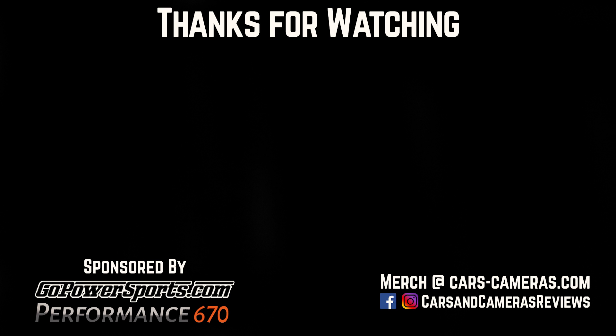It looks professional. Sandblast makes a world of difference for paint. We used a factory 670 muffler - I cut the flanges off the factory muffler. Then Performance 670 supplied us with two U's, and I chopped up the U's to make these two curves. This section is from just some old exhaust off of something - I don't know what it was off of, but it looked good to me. I think it'll sound amazing, probably better than the zoomies we had on it. We should be real close to hearing this thing run.